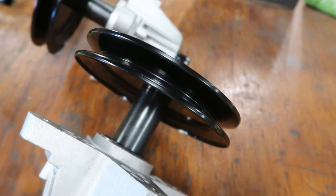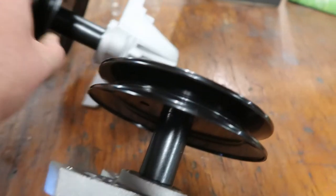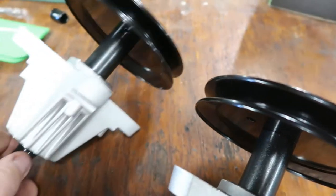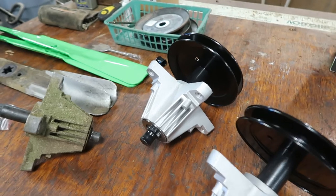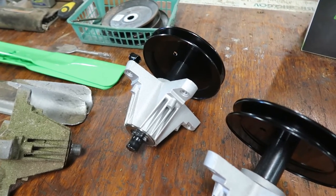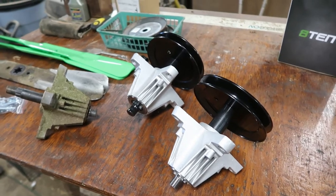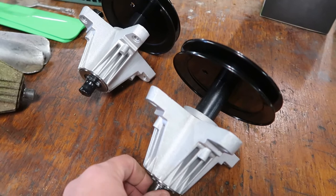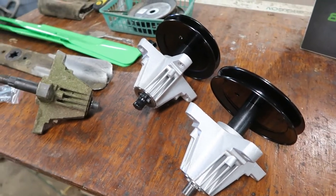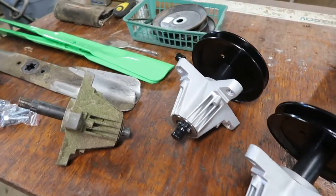It's what does the job — it's what cuts the grass. Spin this new one — there is no noise coming off of here. They've got nice lubricated bearings. How often do you have to replace this? I don't know — two, three, four, five years. Really, when you can spin those blades and you start hearing grinding, or if you're on the mower and you hear a grind or a whine, it's probably time to replace the spindles.